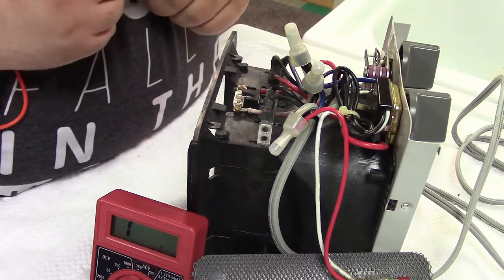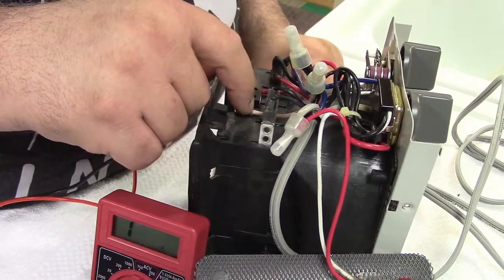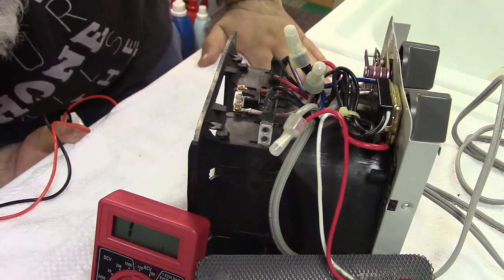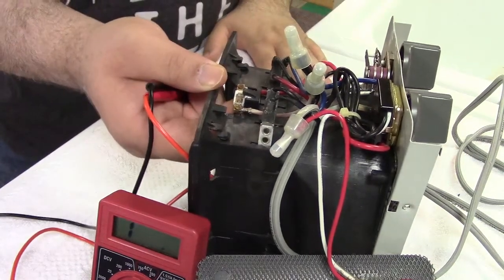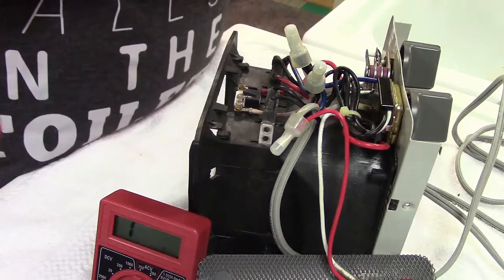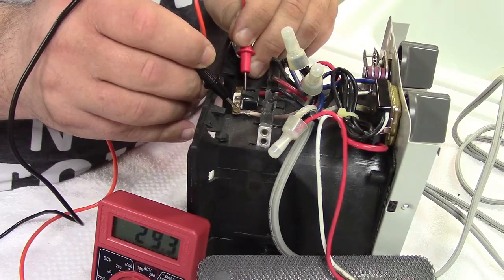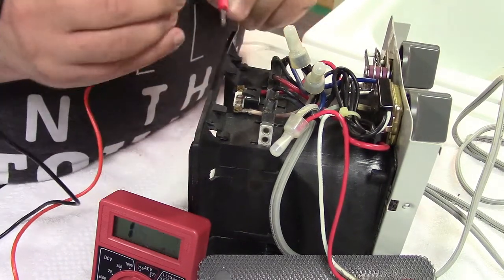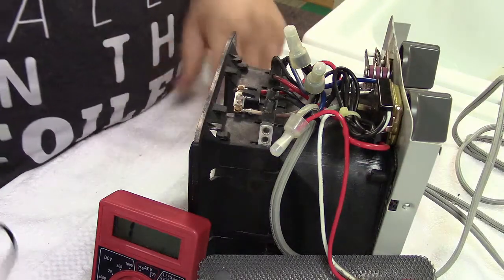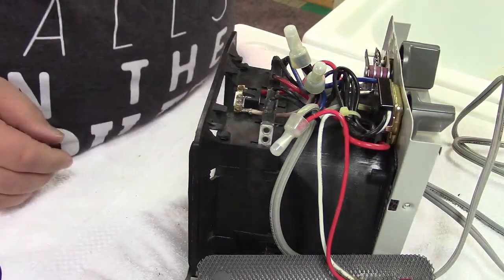The only thing that I am seeing here is this item right here. And that may be the thermal fuse. And my guess is that went bad. It sure looks like one. But it's just totally dead. And when I meter across, you'll notice the meter is currently out of range. And when I touch across, oh, now it is reading. Interesting. It's reading that. I wonder if it'll just magically start working now that I sort of massaged it. It looks like a bimetallic strip.